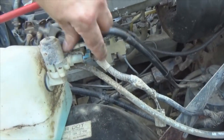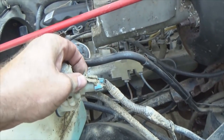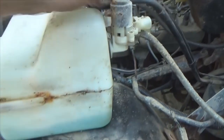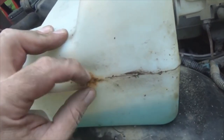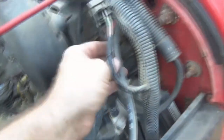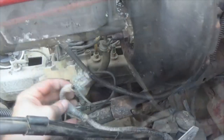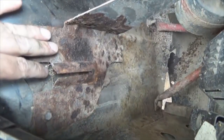I got that rascal out. I've got my little pump hose right there to disconnect. I've got a little bit of fluid in it. For your wiring harness, simply pull the little tab back, wiggle the plug, and it pops right off. I noticed as I got it out there's a little crack in it, so I don't know that I'm going to reuse this thing. Anyway, unhook your hose, get the whole bottle out of the way, tuck your harness back, and get it out of the way — which gives you access to everything inside.